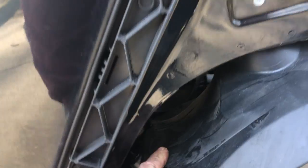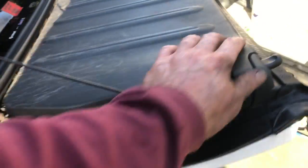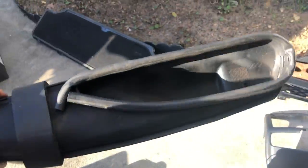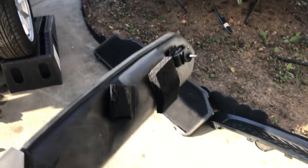On this side, the opening is right here. I think I'm going to go ahead and leave out the air box piping — there's a little snorkel. If I do that, I might get a little bit better airflow, believe it or not, instead of channeling everything through here. So I may just go ahead and discard this.